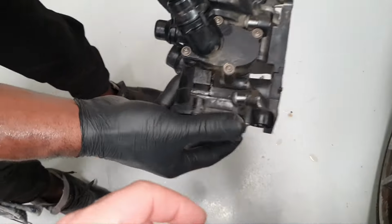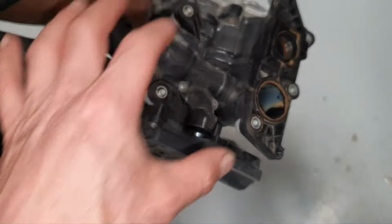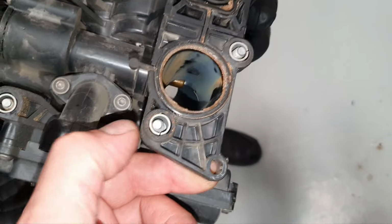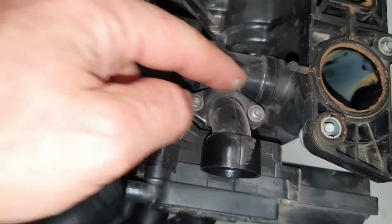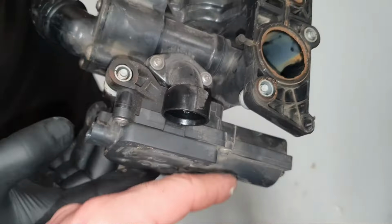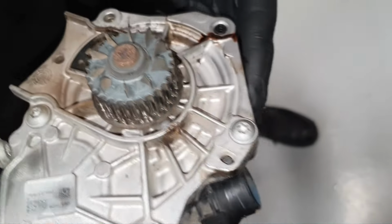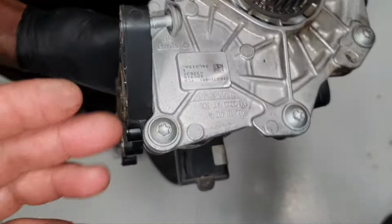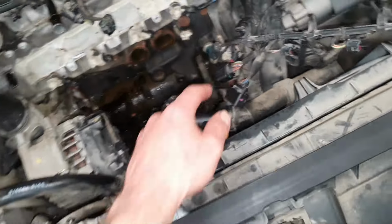You told me that you found one leak. Yeah, it's a good thing to change this part. I'm calling it a heart. Also, these seals look a little bit tired. That's the, wait. Yes, that's a thermostat. The thermostat is located here, and you can modify it if you want, because the 90 degrees that you see inside is not 90 degrees, okay? Fine, hold it there. We see also, yeah, it's a good chance to change the water pump assembly altogether. Thermostat and water pump altogether in one. To change also the small belt there.